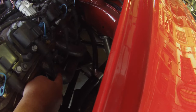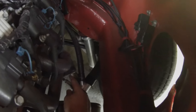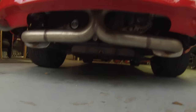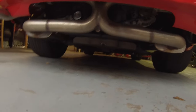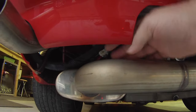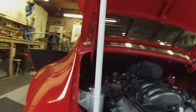The car has JBA shorty headers for a Silverado. All they do is turn right there and come down to these Magnaflow mufflers. It comes back out, and underneath the car it makes a 90-degree turn on either side. It goes through U-bends that are joined in the middle to make a cross-flow. They come out both sides. The tips are on V-band clamps.